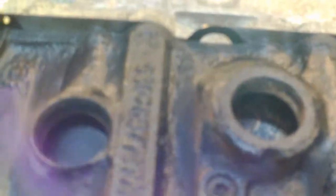Here's a quick better look at that reluctor ring right here. You can see the teeth that are sensed by the crankshaft position sensor, which is right there. It just sticks in here right next to the reluctor ring.